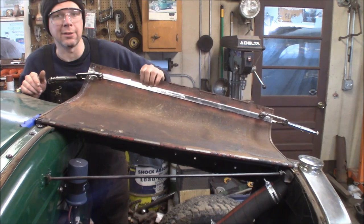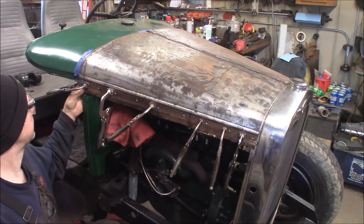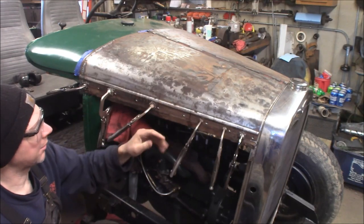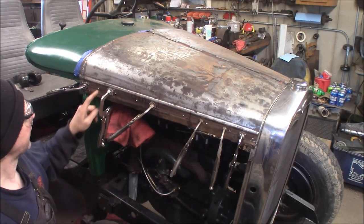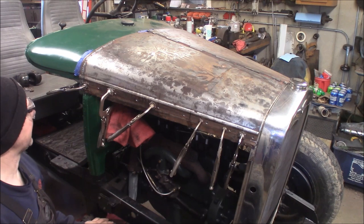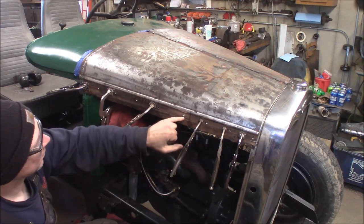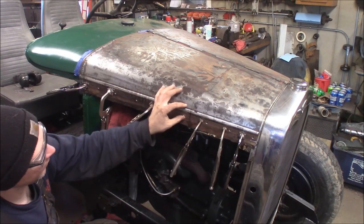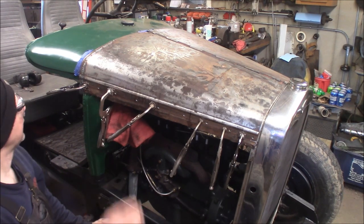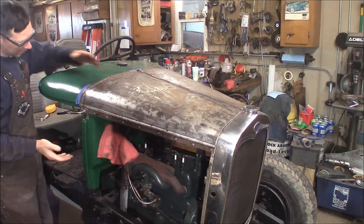You can see this will stiffen up nicely along the edge. I got the hood closed and clamped down where it's got to go. I didn't want any twist in it, so I wanted to make sure it was closed properly before welding. I can just take the MIG welder and plug weld all these holes to attach that piece of flat stock. Then I'll take the grinder and cut off the bottom edge — about a three-quarter to one inch straight edge. It'll be nice and solid. The hood won't flex around and it'll clean up this overhang. Alright, bam — how's that look? I got that trimmed off and ground, it's real smooth down here.